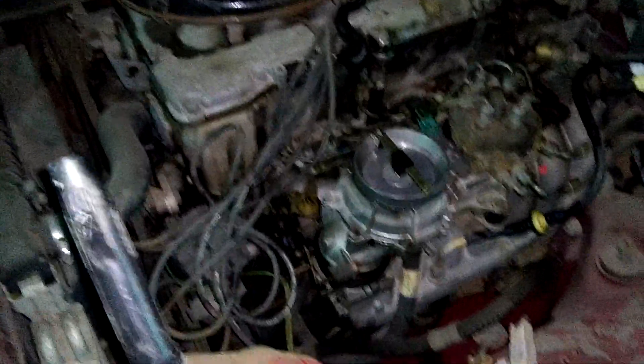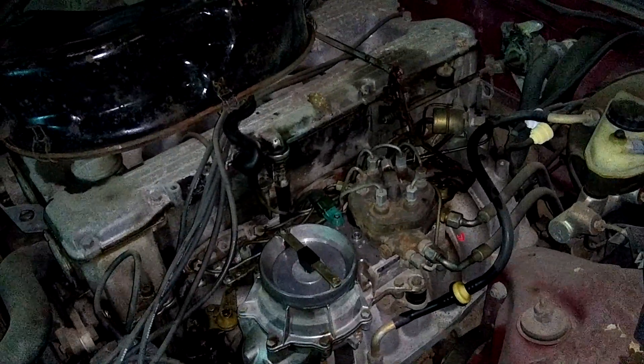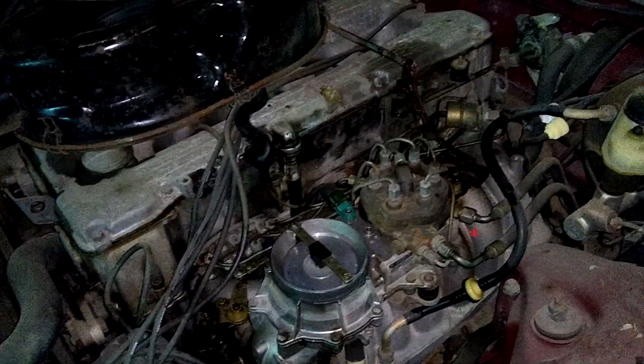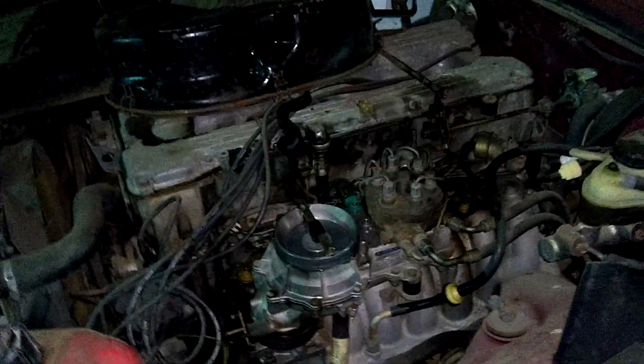What I've done is added a little bit of gas into the intake to help it along. The car would run but I think the accumulator is bad, and as a result it just wouldn't build up fuel pressure. So I'm effectively adding fuel to the system, which should give it enough juice to keep it running and then it should be able to run on its own accord, assuming the fuel system isn't banged up again.